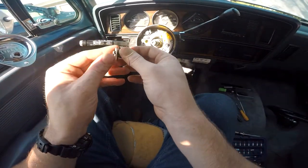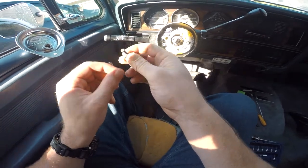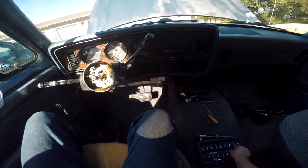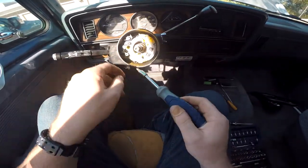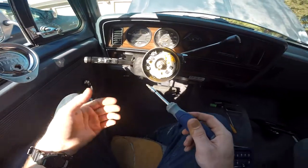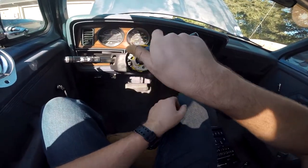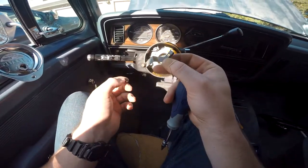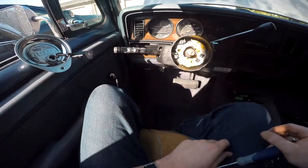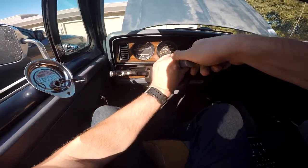This hazard switch screw is one piece you need to remember — it's the long, coarse, skinny one that goes in there. Put that in your magnet tray. Now put your number-two Phillips back on. Start with this screw here that interfaces with the bar that engages your turn signal lever — that's how it moves. Unscrew that and get it out of the way, then pull all the other three out and it will come free.